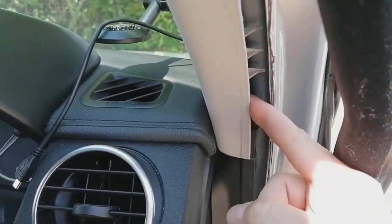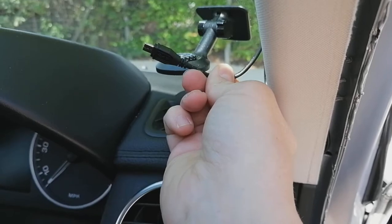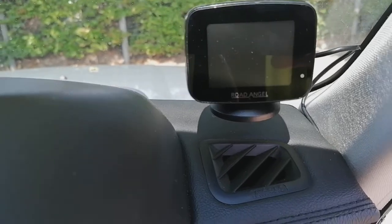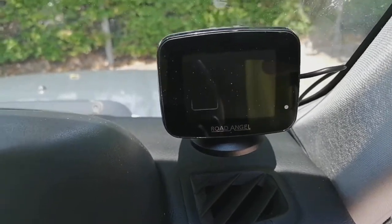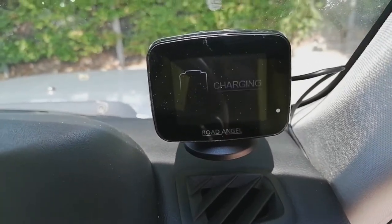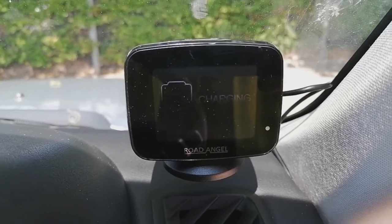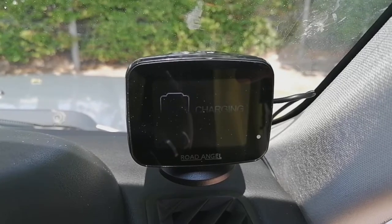Now we're on the driver's side of the vehicle. The power cable has run down from the top of the windscreen underneath here and pops out conveniently where the Road Angel is going to go. We plug that into the Road Angel — we've got a power light. Pop the ignition on and there we go, successful installation. The battery is flat at the minute so it's going to continue to charge, but it works. That's how you power your Road Angel from the fuse box on one of these vehicles. Use the same basics on any vehicle: test the fuses, get the manufacturer's fitting kit, and away you go. Any questions, contact your supplier or local garage. Thanks for watching, bye for now.